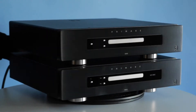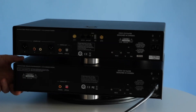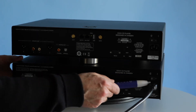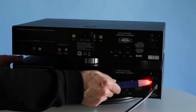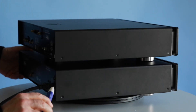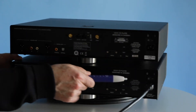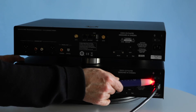The AC polarity pen works in this way: once you have the product plugged in and turned on, take the polarity pen and place it on the inside edge of the power cord — it should light up. Then take it around to the other side and it won't light up. The pen should light up on the inside edge, and that's really all you need to do to test it.